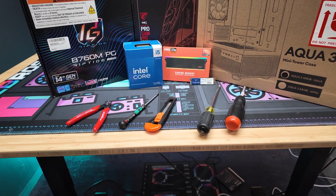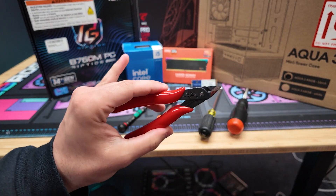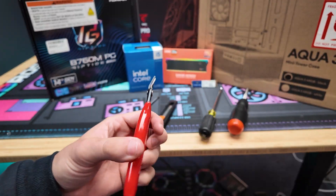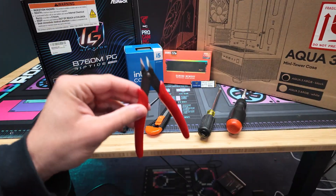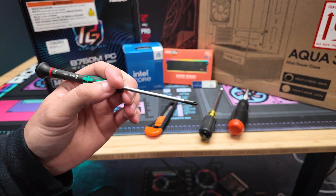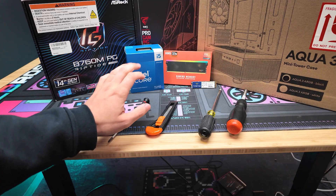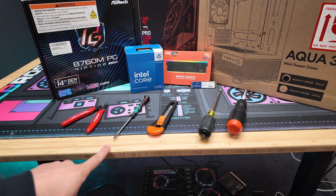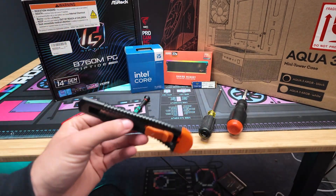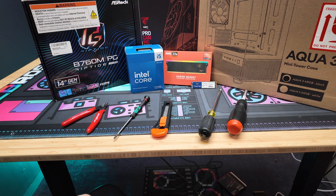To start, I'm going to show you all the tools you're going to need to build a gaming PC. From left to right: first up we have clippers or wire cutters — these are essential for the cable management portion to cut off the excess. Next up we need a PH1 Phillips screwdriver, the smaller one, basically just for M.2 screws. A multi-screwdriver with a smaller bit works too. We also have a box cutter — you want to make sure when opening all these boxes that you don't tear them in case you have to ship them back.